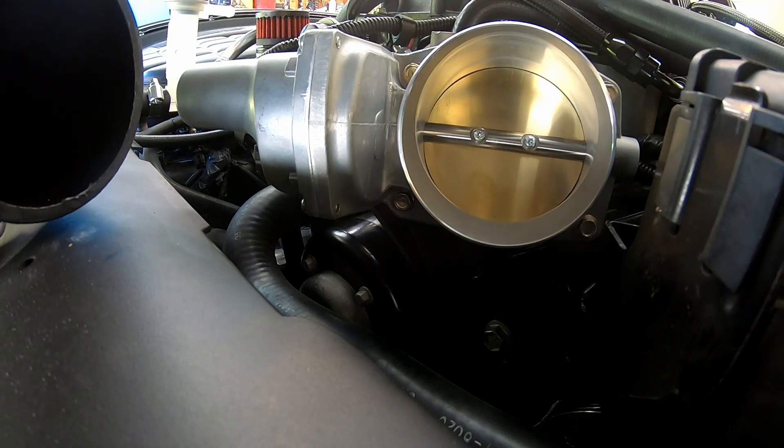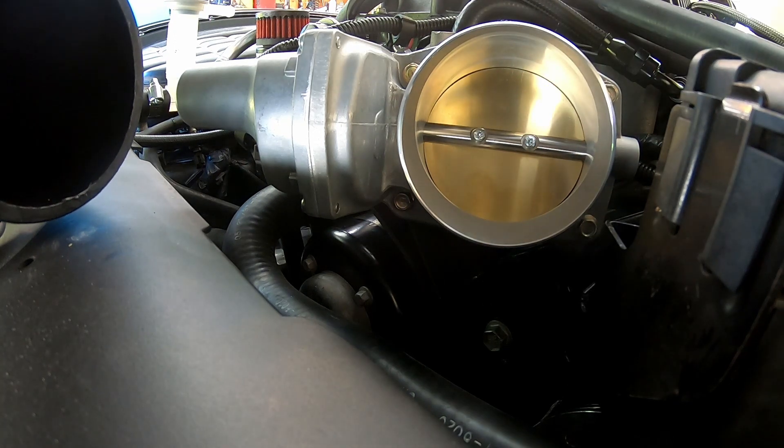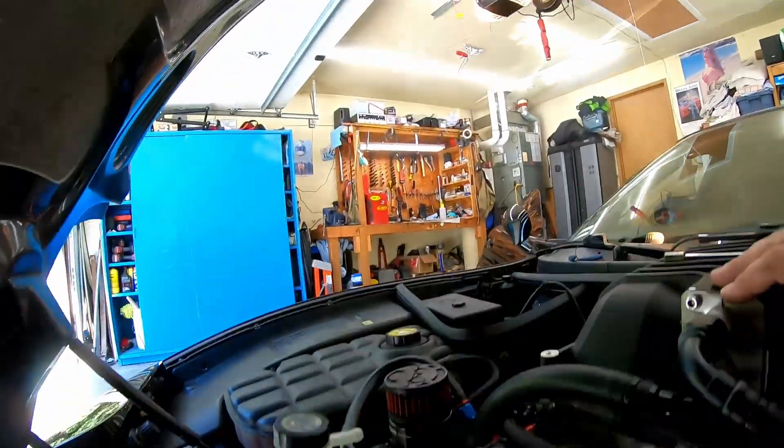Okay, so that was pushing the throttle all the way open, and it did look like it actually does over-travel a little bit. So we're going to grab the laptop and make some settings changes to see if it makes a visible difference in the throttle blade.